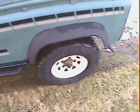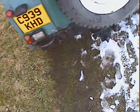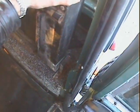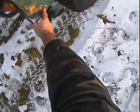Carrying on around, the near side rear wing looks pretty good. Around the tail end it's obviously had some work on the rear cross member at some point, but I think you'll find they all have. There's a little bit of electrolytic reaction along the bottom of the near side closing panel by the reversing light. The off side is fine there. In the back, all the seats fold down and there are smaller seat belts. All the seats are cloth in the back except for one which has a vinyl base — the cloth seat probably got damaged. It's got a fibre headlining.